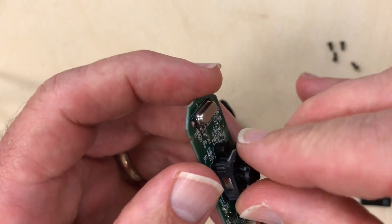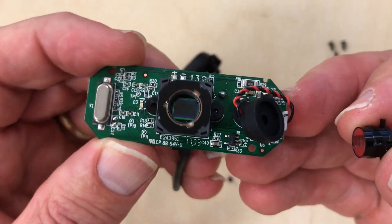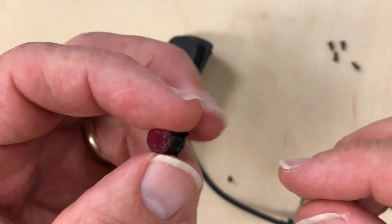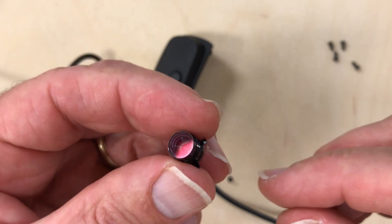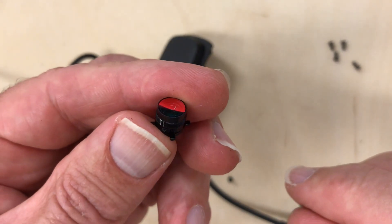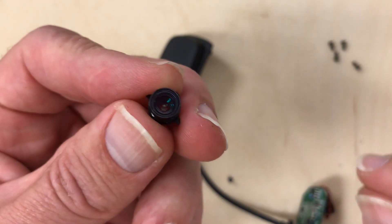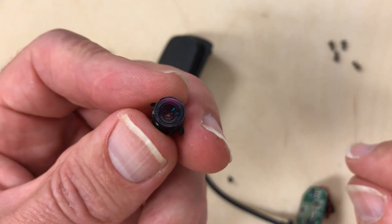This is the lens. There's the CCD chip with what looks like a little protective cover on it, and then lo and behold on the other side of the lens is the infrared cut filter. I need to remove that. Unfortunately it's glued on to the end. I'm going to pause and try a few other ways because I want to see if I can get it off intact, since it's kind of cool to experiment with and see what frequencies get through it.